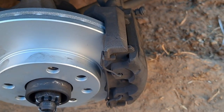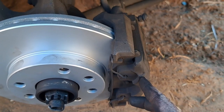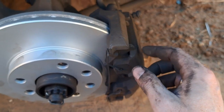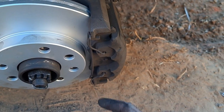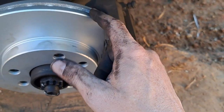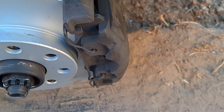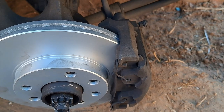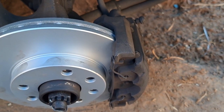Just another tip to remember: when you put the caliper on, before you put it on remember to push your piston all the way back - in other words, open up your caliper to maximum. Otherwise you might have a problem getting it over the new, much thicker disc. After I cleaned it with the carb cleaner it actually moves without any effort. So hopefully that will solve our little problem.